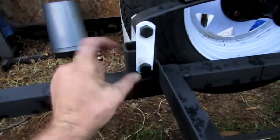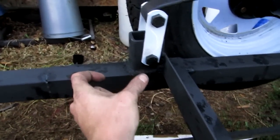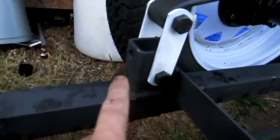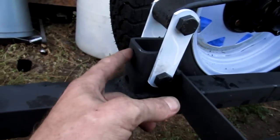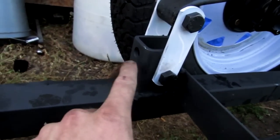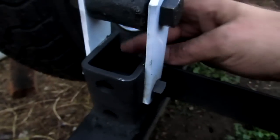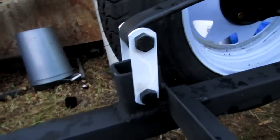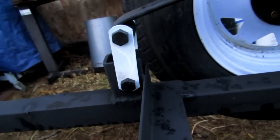What I decided to do differently on this is the perch normally is laid down like this, and then you plug weld these holes, or you can use bolts. But since I don't think my little Harbor Freight wire welder will be able to plug that up at the same time as welding it to the steel, I decided to stand it up alongside this angle iron right here. So she's welded down, across, around, and then up the other side. So yeah, that's looking good.